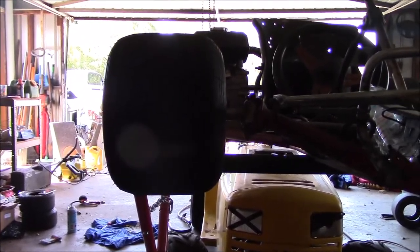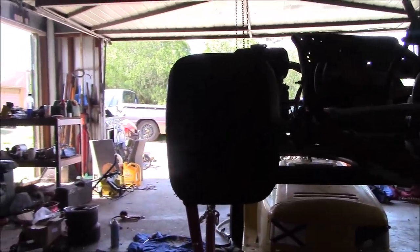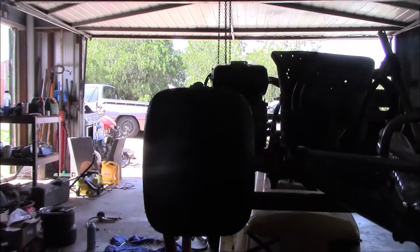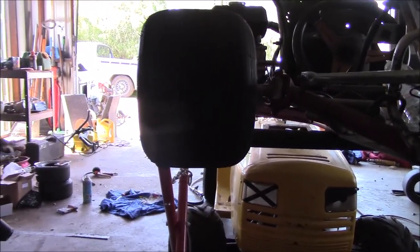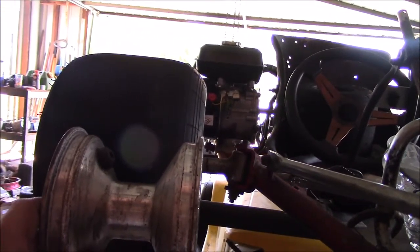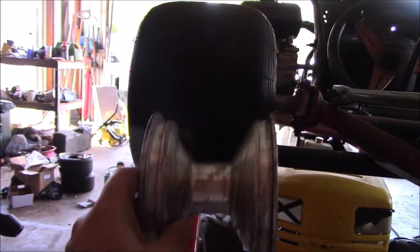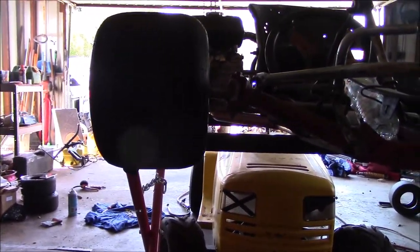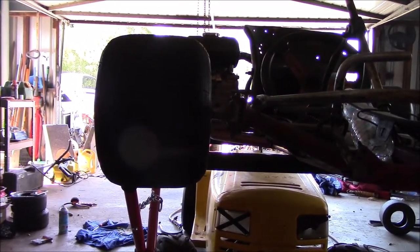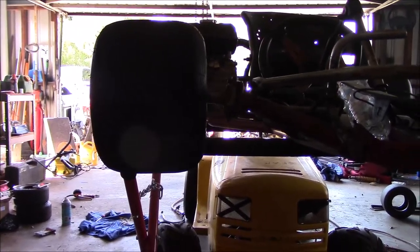That's the hub, new wheel, and tyre assembled. As you can see, when looking down the profile of the cart, the front wheels are actually more in line with the back wheels now. This is the original rim — it might not look that big, but when you stick it up in reference to where it would have sat before, that's the difference. Similar to a four-wheeler — because we use these carts for sliding around — you want the front track as close to or wider than the back track to help with turn-in. So that should make my life sliding around a lot easier.